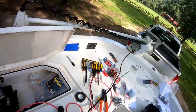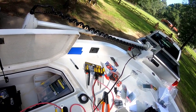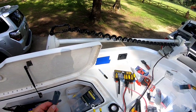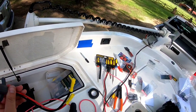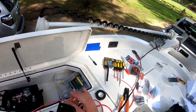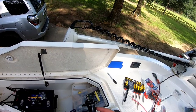This is not hard, guys — you're going to be amazed at how easy it is. So let's get right into it. This is the Motor Guide XI5 36 volt, 72 inch shaft. I'm going to cut the factory ends off and splice into this plug. The receptacle is right here, and you will have to drill a hole in your fiberglass with the correct hole saw bit to fit it.